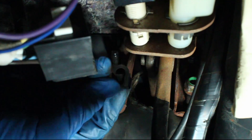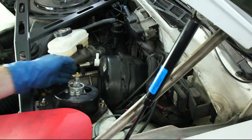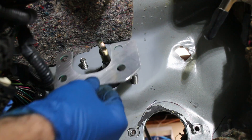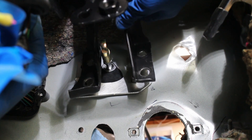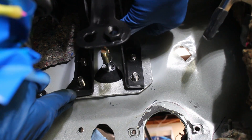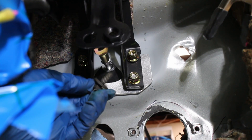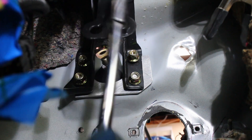Remove the brake booster clip and rod from the pedal, then loosen the top bolt on the pedal box. The booster studs only need to be backed out of the firewall and not completely removed. The reinforcement plate sandwiches between the firewall and the pedal box. These shots are with a different bolt than the OEM brake booster, but it's overall the same process. Once the plate is lined up, the pedal box can be bolted back in — it gets bolted in with 1 bolt and 4 lock nuts.